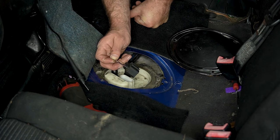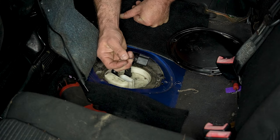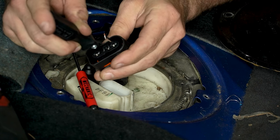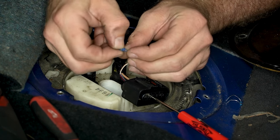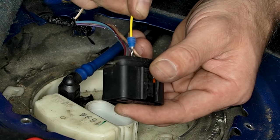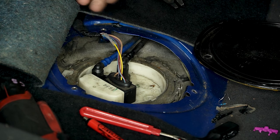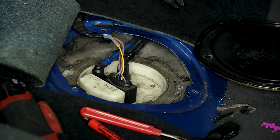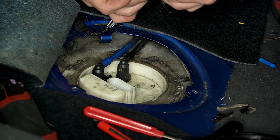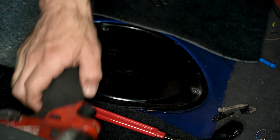Just like that, a little tug and we found it. No need to go any further than just right there. We'll see if we can repin this — we've got the OEM factory ones. That's our culprit: just a little bit of a broken wire. You don't ever want to make that splice too close to the connector in case you ever have to do it again. Now let's plug her in and see if it works — we'll come back and shrink and retape this, but I want to make sure it works first. We also got to put our secondary lock back in, and it works. Outstanding. Let's go ahead and get this put back together properly with all of our secondary locks installed, then put our cover back on and move on to the next thing.